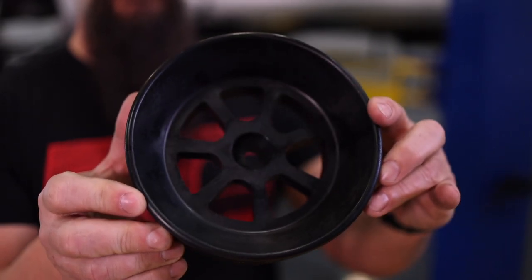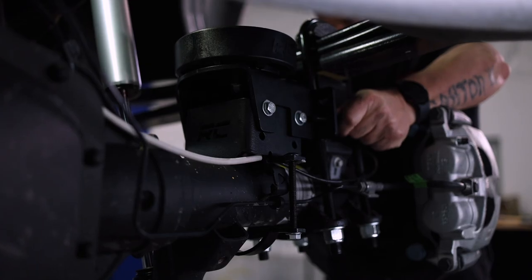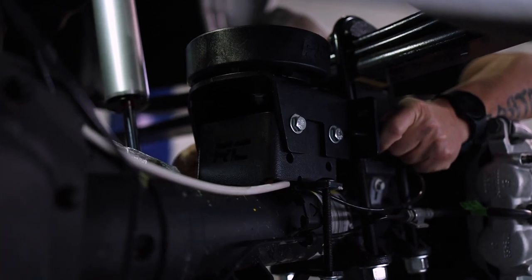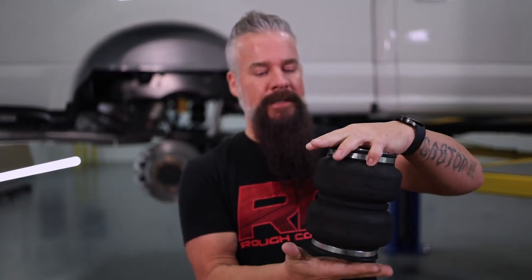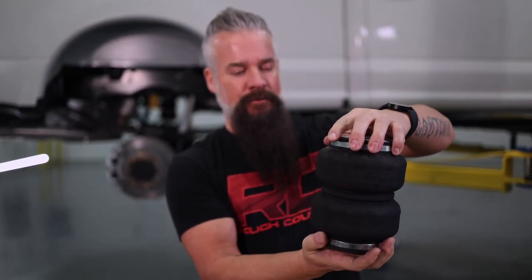So what is an air spring cradle and why do you need it? The air spring cradle is going to replace the hard mount of the lower portion of your air spring, and what this essentially does is allow your suspension to cycle fully. A lot of times your air spring is typically hard mounted top and bottom, so it can in effect become a limiting strap.